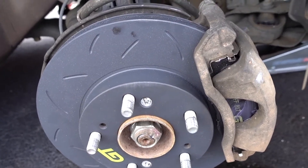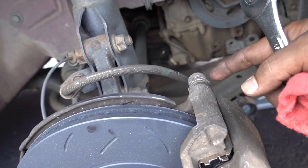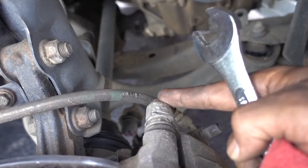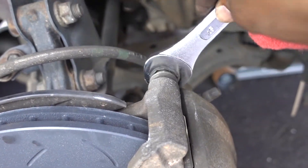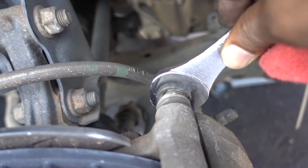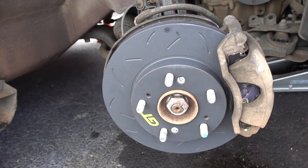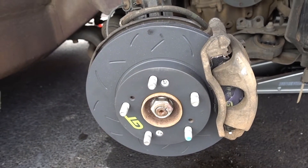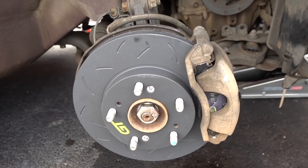This side is done. Last tips: don't forget to remove the caliper pins, get them lubricated. When you try to tighten the caliper bolts, the pins will just spin. Grab a 19-millimeter wrench, hold the back of the pin while you tighten the bolt. If you have any questions, comment down below — I'm happy to help. That's it for this one, hope you liked it. Thanks for watching, don't forget to subscribe, and see you in the next one!